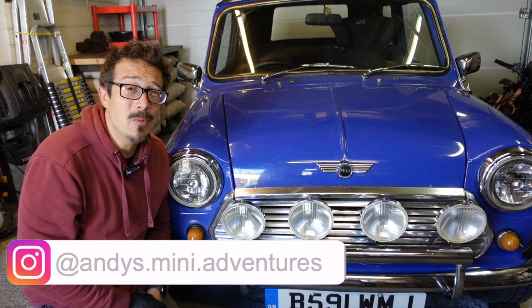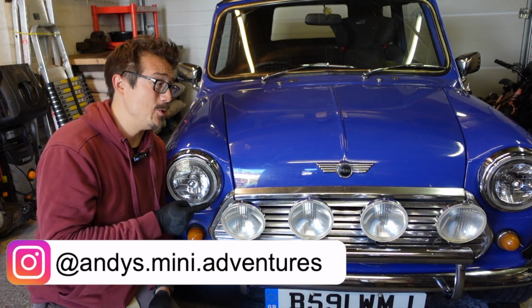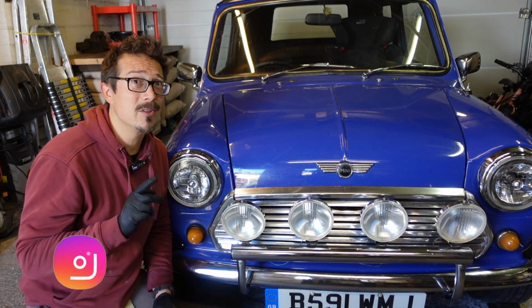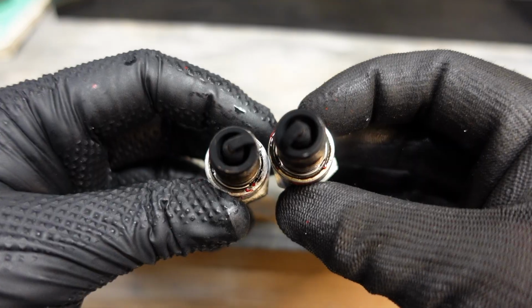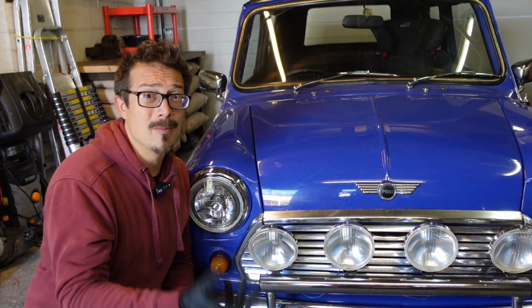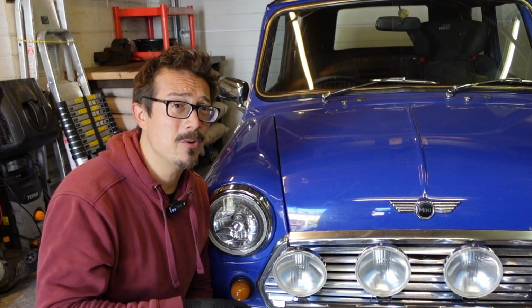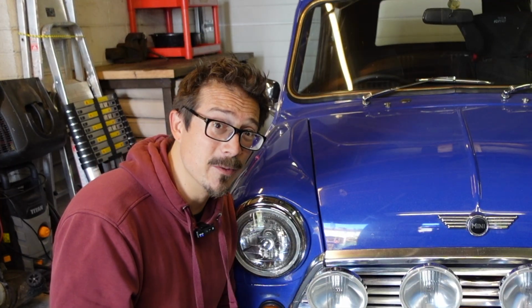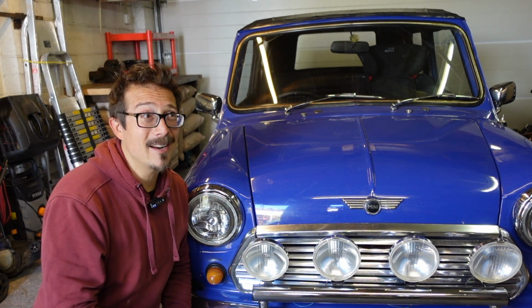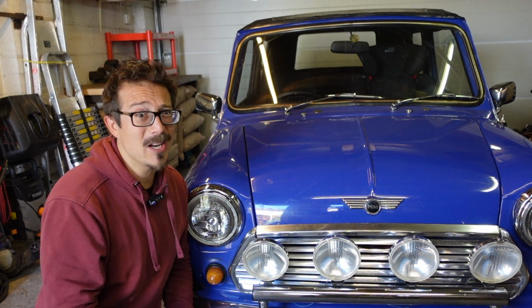Now, as you'll see from one of the first videos I did with this new classic Mini, I changed the spark plugs, and I found that plugs 2 and 3 were very black and sooty. I know there's a load of you that have told me what it could be. Could be to do with carburation, could be something with the manifold, could be a dirty air filter. So, today's video is going to be about cleaning your cone filter on your classic Mini.